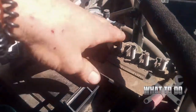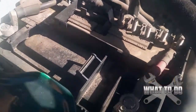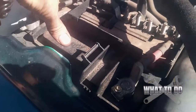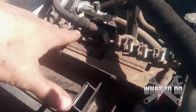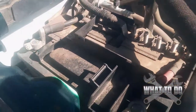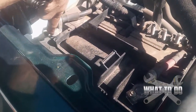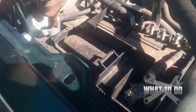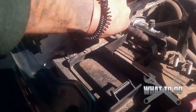Looking at this battery, you can see it's got a lot of terminals on this junction box up here. If this is your first time changing this battery, you might get a little overwhelmed thinking there's all these things connected. But it's actually quite simple. What you want to do is get a 10 millimeter and loosen up your negative cable — pull your negative off first.